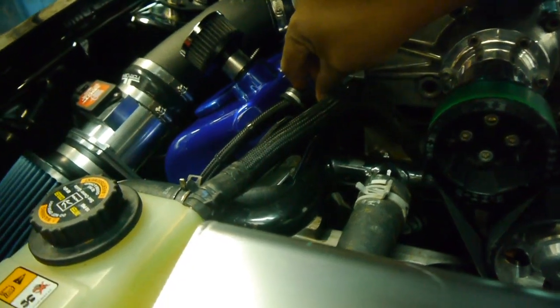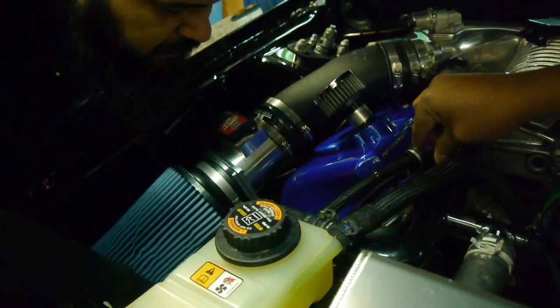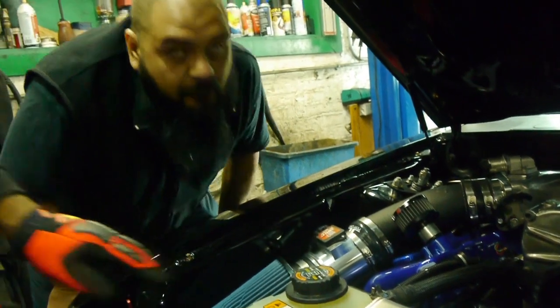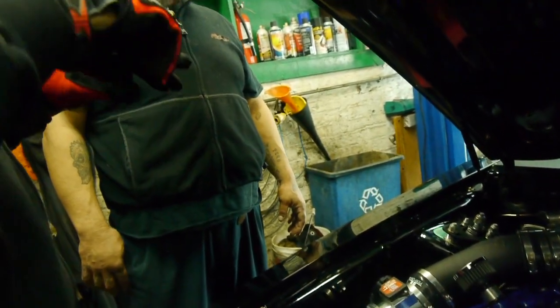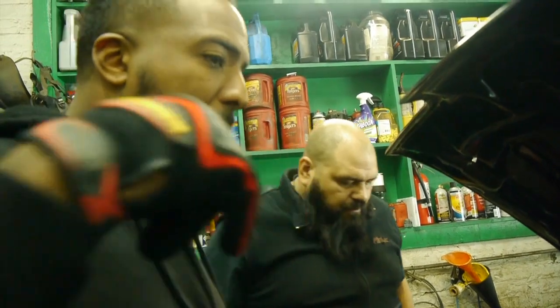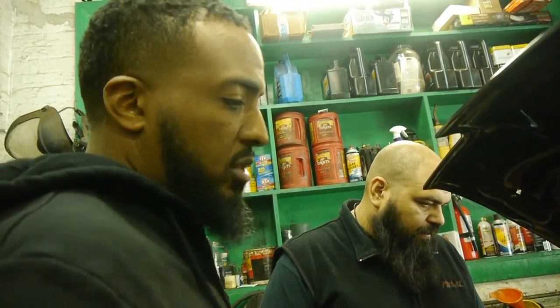And this is what I was saying. Dude, everything is coming from this right here. So the new lines that we run will go to this, actually to these two pieces right at the bottom. That's where the other lines will go. Everybody's telling me it's hard to connect PTFE lines, that you have to have a special tool. Whatever, fine. My whole thing is that I believe these are PTFE lines, because if I want to run E85, it has to be PTFE or else the first time we run it, that thing is going to melt and everything's going to tear up.